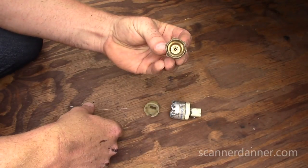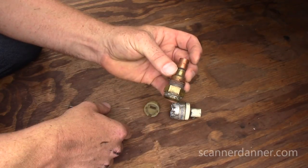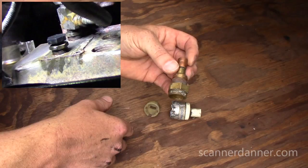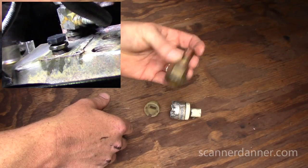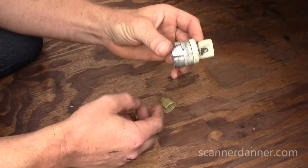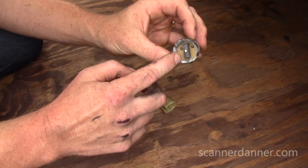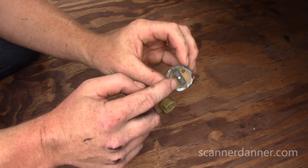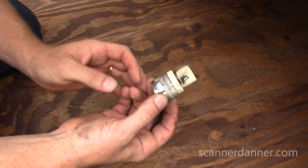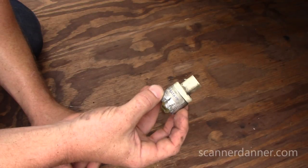This is the piece that was still left in the block. Right now I've got a black plastic half-inch pipe thread plug in there just to keep the coolant from draining out. This was still in the block, broken — you can see the aluminum housing split apart, and that's what ruined the switch. Internally it's just an on/off switch. I started trying to find this part — it's made by Medallion, it's an alarm stat.